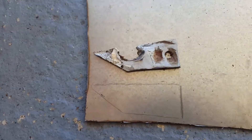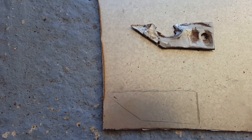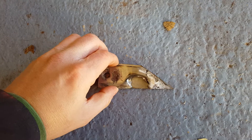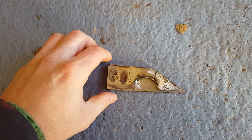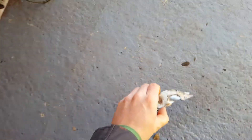So I'll just try and flatten this as much as I can, find a decent bit of steel, and mark around it with a pencil. As you can see, the pencil's marked around the piece — we're going to replace this with a whole new shiny bit. Just a case of cutting along here all the way with an angle grinder and testing it to see if it fits. Old part, template made, cut — new part. Something very satisfying in getting the rot out and putting new parts in. This one has got quite a lot of rot. The best advice I could give is take your time and do it right.